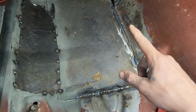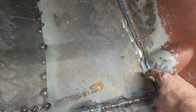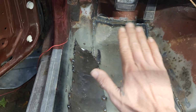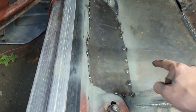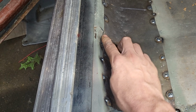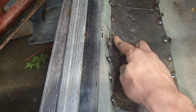Like I said, if I was to do it again, I would have made this underneath it come up about an inch on the inside all the way around, and I would have just set this piece. I would have bent it like I did, bend it up, and then bend that corner up, put it where you needed it. But I would have had a lip, and I would have done like I did here. See, this one, there was a big old gap right here under it, so I figured no point in trying to weld that little spot weld.